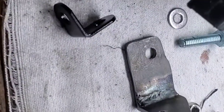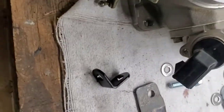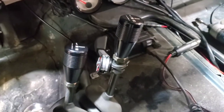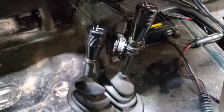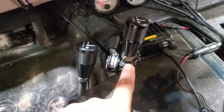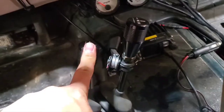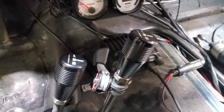The thumb portion mounts to your TK shifter — you can pick whatever shifter you want. I chose to do it off the rear stick, in between the two shifters, so it won't get accidentally bumped when I'm all the way forward in low. I can still easily reach down and adjust it. It comes up and back is how you adjust the thumb throttle.